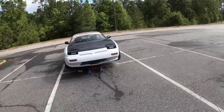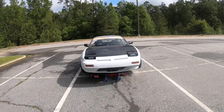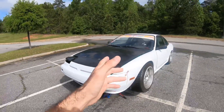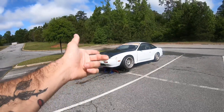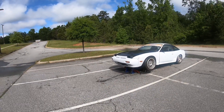Alright, we're back at it again. Just so you guys know, if you want to lift the oil pan out of a 240SX that has a CA18DET swap — and I'm assuming the SR20s as well — you actually have to hoist the engine up out of the bottom K bar. So just so you guys know.